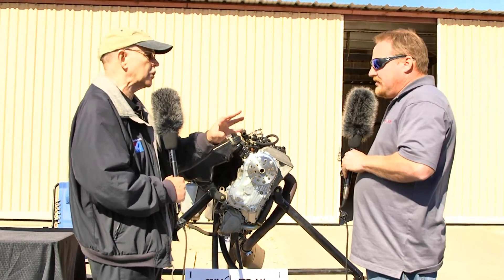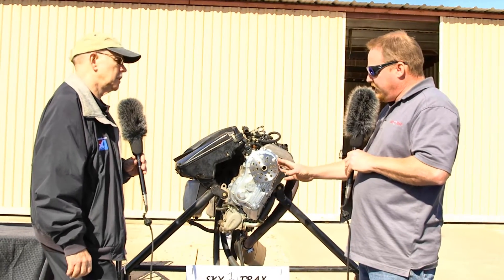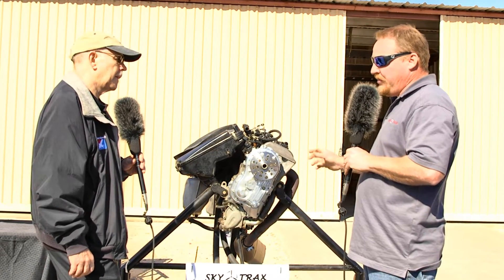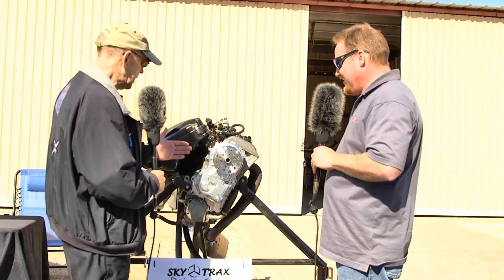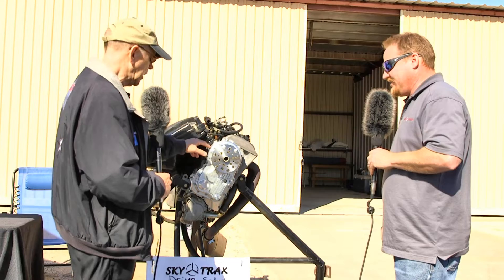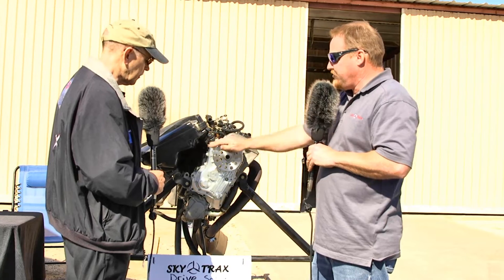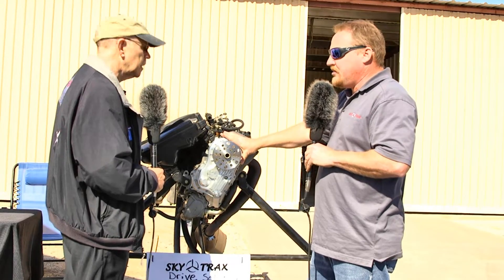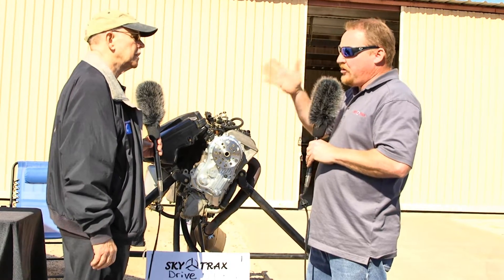The other parts are the same — the gear ratios are 3.11 to 1 in the gearbox. It's important to note that this engine internally has a 1.23 to 1 ratio, so combined between the two it works out to 3.83 to 1 from engine to prop. This one also has a clutch — a large sprag clutch. It can free-spin in the direction of rotation, which is the same as the 912 engine.